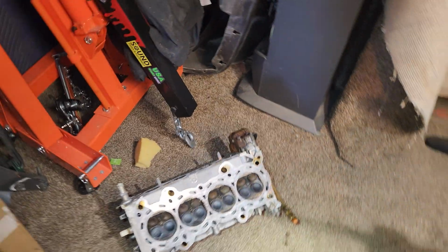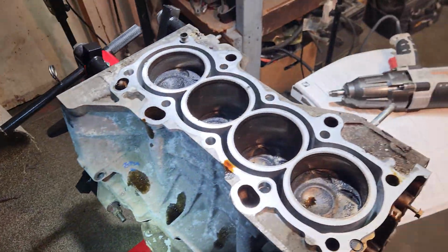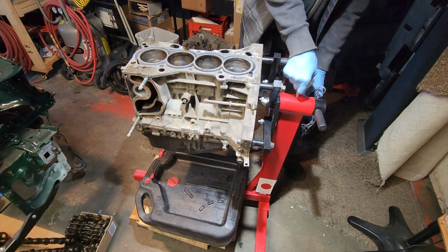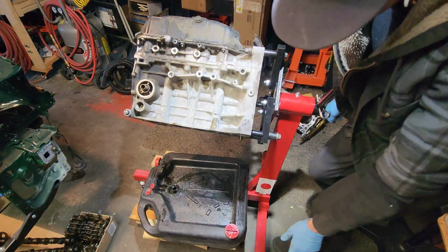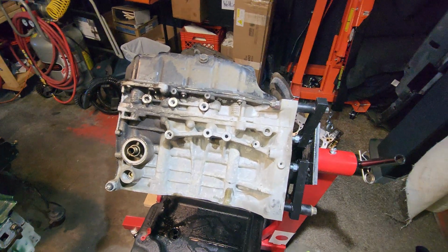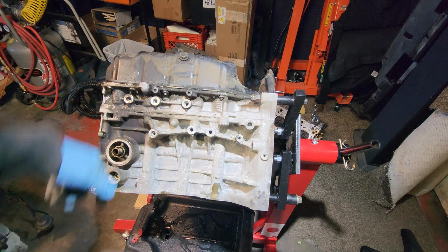Well, don't run the engine without oil, because the tensioner relies on oil pressure. So there you go. Alright, continuing on. Alright, so while that's drippy dropping, I'm going to go ahead and pull this and looks like I bent the dust shield somehow. No biggie, that comes back. I'm going to zip this guy out.